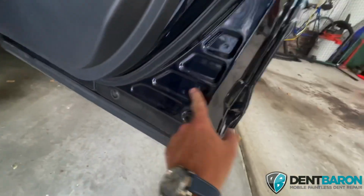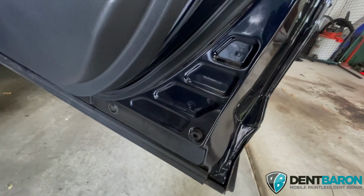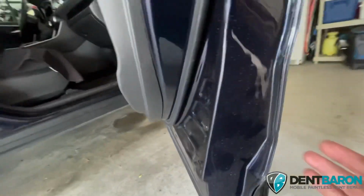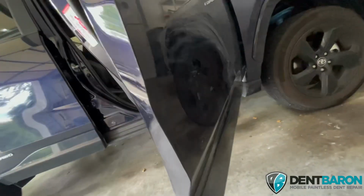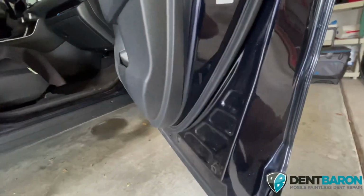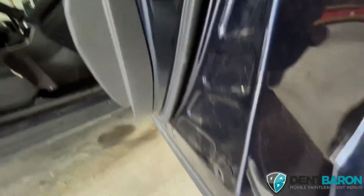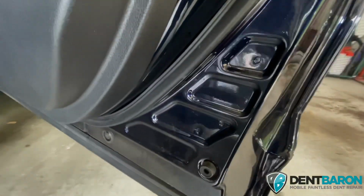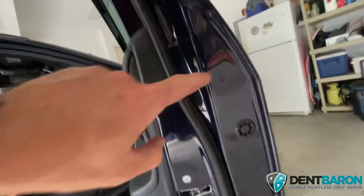And you do have these welds, which let us know that there is bracing and/or an intrusion beam that goes across this area. So it's going to be a little bit of an obstructed, damaged area. You see the weld there as well. So that's a way to know that there's going to be bracing in the way, same as here and up here.